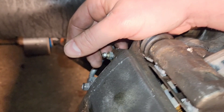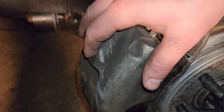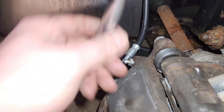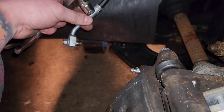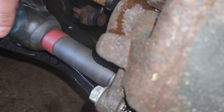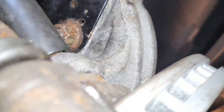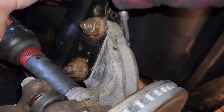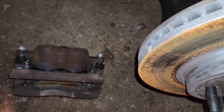In this case, I'm just going to remove it, let it hang, and then remove the whole caliper assembly together. Use an 11 millimeter socket and have this removed. You'll drip a little bit of brake fluid. I'm using power tools so it makes it pretty easy to get these bolts out. Since it's old and we're getting rid of it, we don't really care much for it.